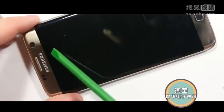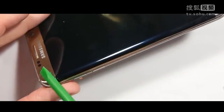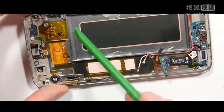So a charging port repair is pretty impossible with this phone unless you're doing a screen repair at the same time. To remove the screen from the frame, you're going to use the same process that you use for the back of the phone with playing cards and heat. It will destroy the old screen though, so make sure that you do have a working replacement.